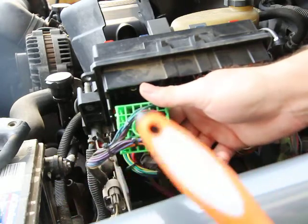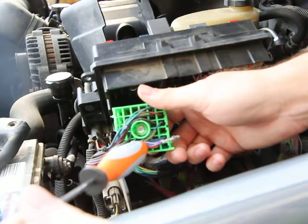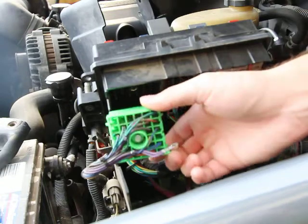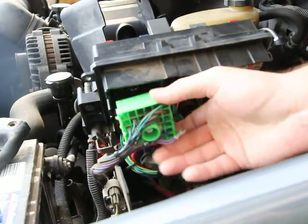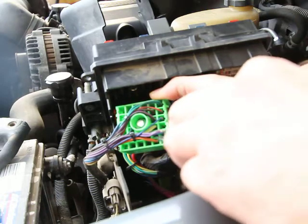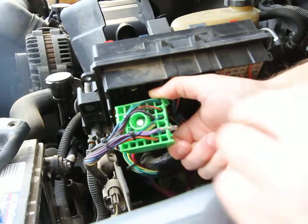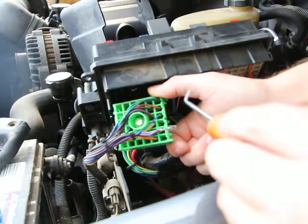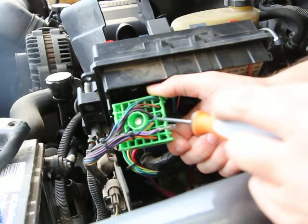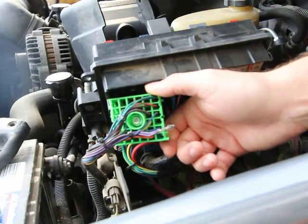The wires we're going after will be the two that come in your kit with one pin. Factory wires are purple, and they are going into the A3 position. So when you pull it out of the box and tilt it up, the top is 6 and the bottom is 1. So A1, 2, 3 will be where you put in your connector for your fog lights, or if you count it down from the top — 1, 2, 3, 4 from the top — which will also be the A3 location, will be your connection for the fog lights.